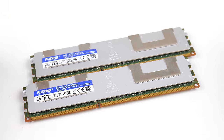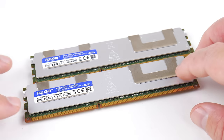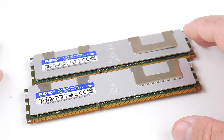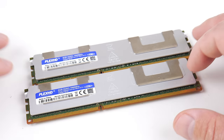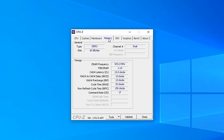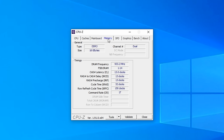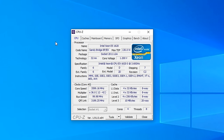This is the RAM we're using. One of the highlights of LGA 2011 is that we can use server memory — registered ECC — giving us error correction capabilities for a more stable system. It's meant for workstations and servers. This is a 16-gigabyte kit at 1866 megahertz. The timings are unfortunately a little loose at 13-13-13-32, and there's no way to change them as the BIOS is locked down in that regard. But the performance was still fairly capable. You're looking at around $40 to $50 for such a memory kit.